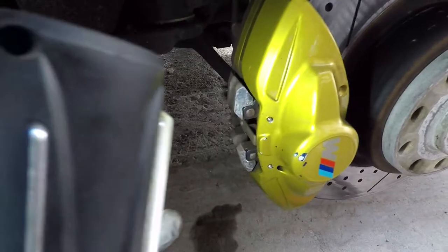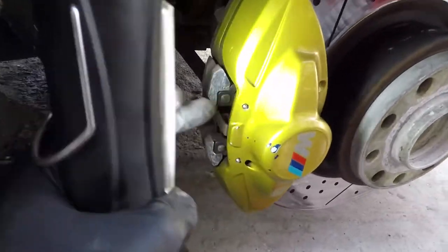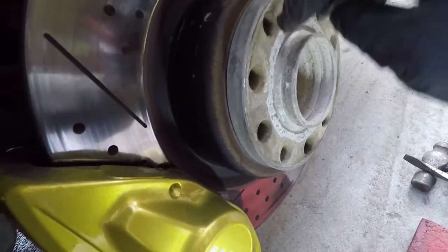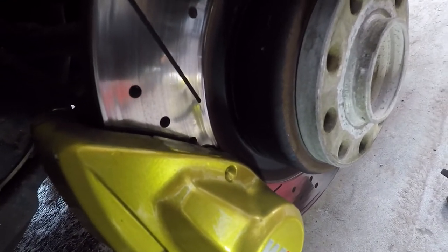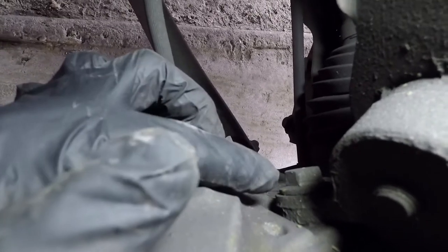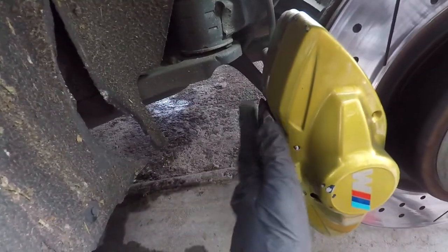The tire's off and I've got a light here so you can see — my brake pads are very low. Here's the pin I was talking about. If you want to change your rotors, because I've got spacers, there's a screw behind here — I think it's an allen key or Torx 30, not sure. To remove the caliper it's just two bolts, 17mm — this bolt here and this one. Remove the caliper and you can remove the rotor. There's no carrier for the caliper on these models.